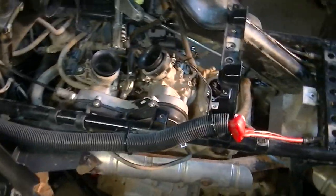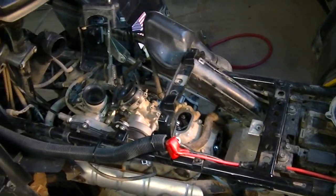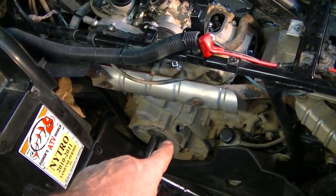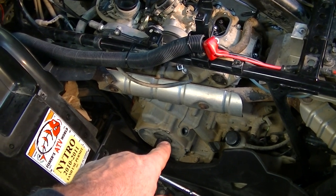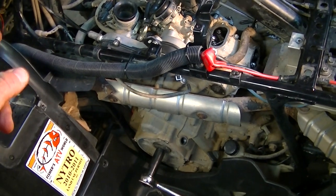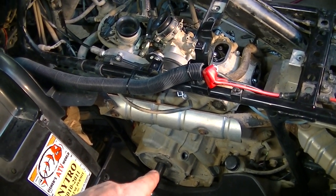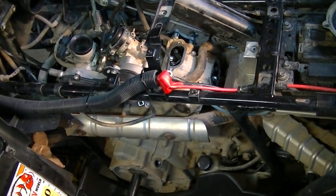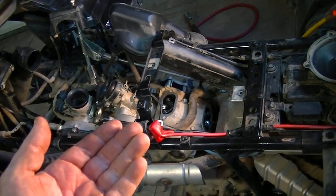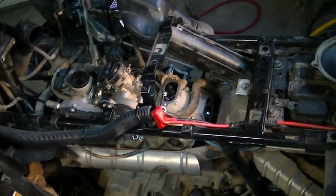I'm not going to go through this painful exercise of showing you this — it's the same on the rear as it is in the front. But you want to make sure that you look through the service hole, the inspection cap there, and make sure that you're on compression and on top dead center for the front. And when you do the rear, same deal — make sure that your valves are loose, you know you're on the compression stroke, and then you can adjust them. So that's how it works.